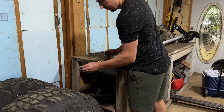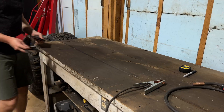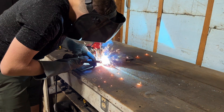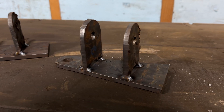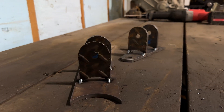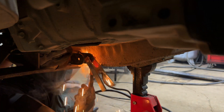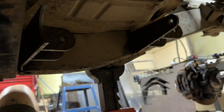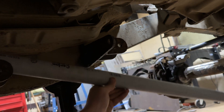Welcome back to DNS Fabrication. Today we're going to be building out our three-link suspension for a Suzuki Samurai, and we're going to start by building out some mock links with some PVC. The motivation behind these mock links using PVC is to figure out if there are any interferences between the links and the rest of the Samurai. In this example we actually find that the lower link is a little bit too far up and we're colliding with the upper link mount.